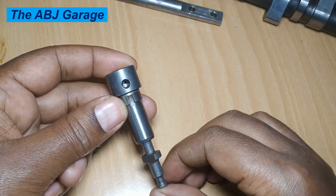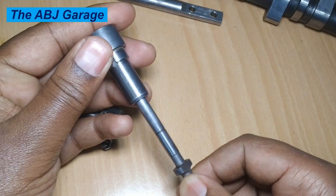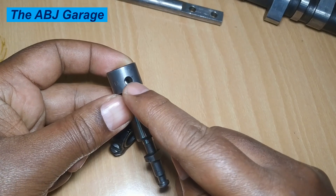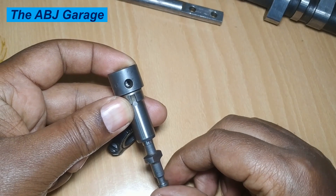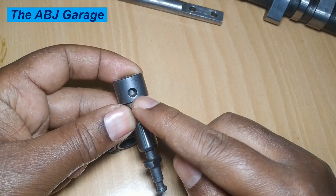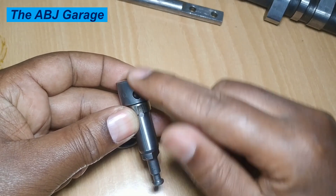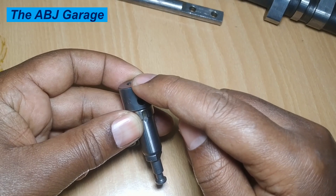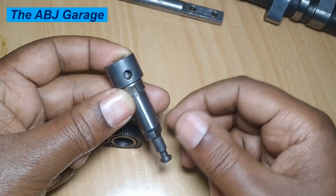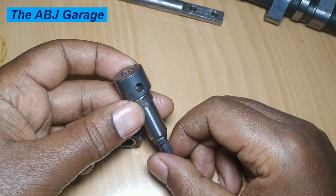Now with the plunger inserted, you can see that because the plunger is below the feed port, fuel can enter the chamber. When the plunger moves up, the feed hole is covered by the plunger so the fuel is isolated. Further travel of the plunger pressurizes the fuel inside the barrel — going down sucks fuel in, moving up pressurizes and injects fuel.